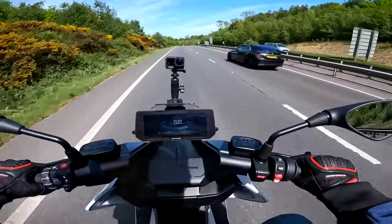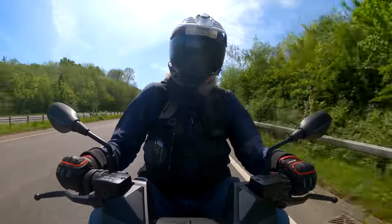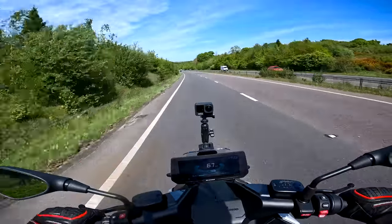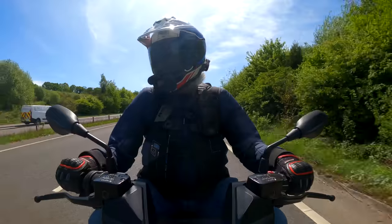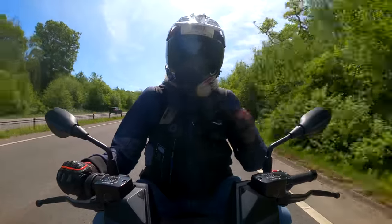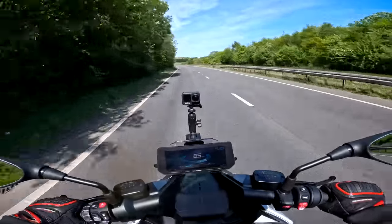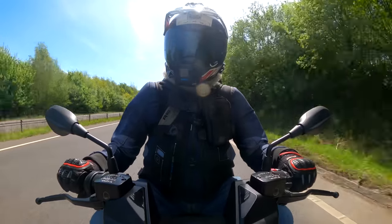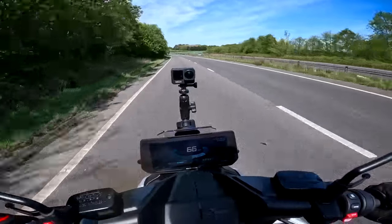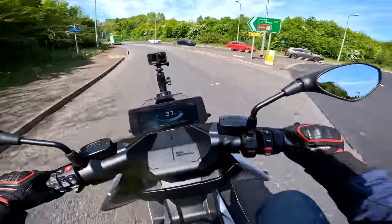I'm not going to go crazy here because I'm getting down to 26% battery. I'm assuming this is going to be like other electric bikes: once you get below 20% performance is severely restricted. Ideally with electric you want to keep between about 20 and 80 percent charge, top up fairly regularly, and with the fast charges on the likes of Energica and Zero bikes you can get away with a quick 5 to 10 minute blast and you're off again.